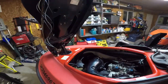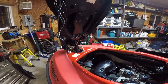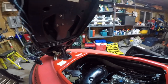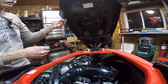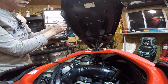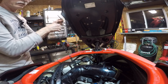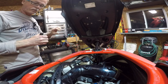This is electrical issues. They are difficult to figure out, but we're definitely closing in on it now. We know everything else works just fine, so whatever it is with this tether circuit, we've got to figure that out. So let's get after it. Rigged up a ground. Tied this lead into the tether wire where I twisted them up top, purple black. Connect here. Click, click. Now it's activated. There she is. We're closing in on it.